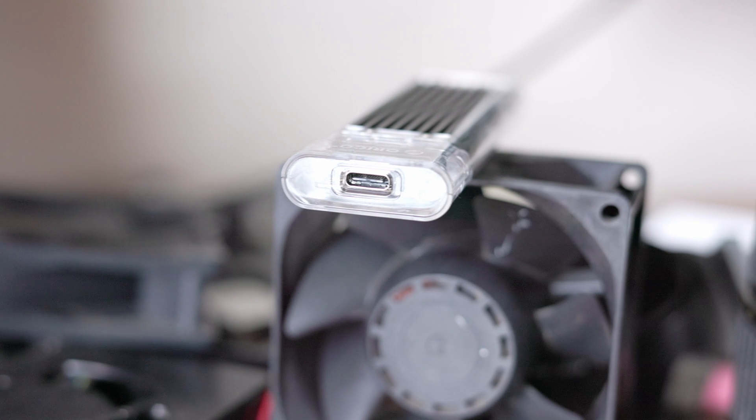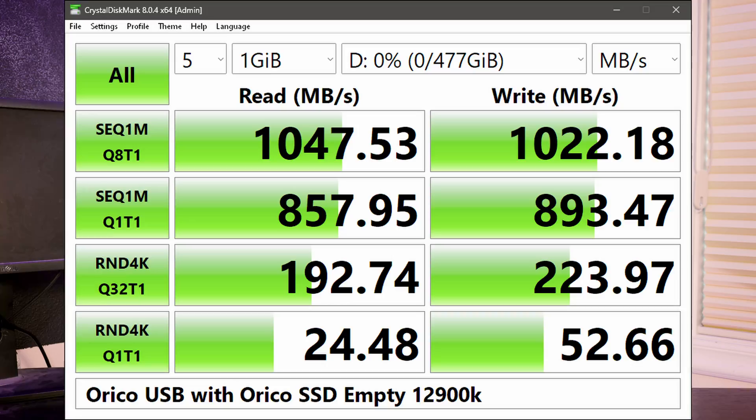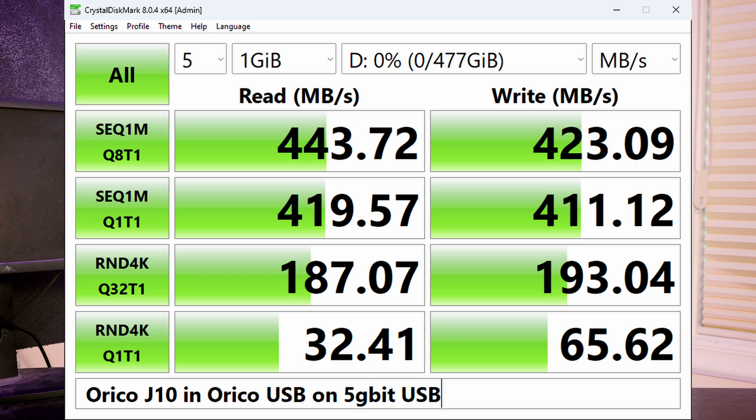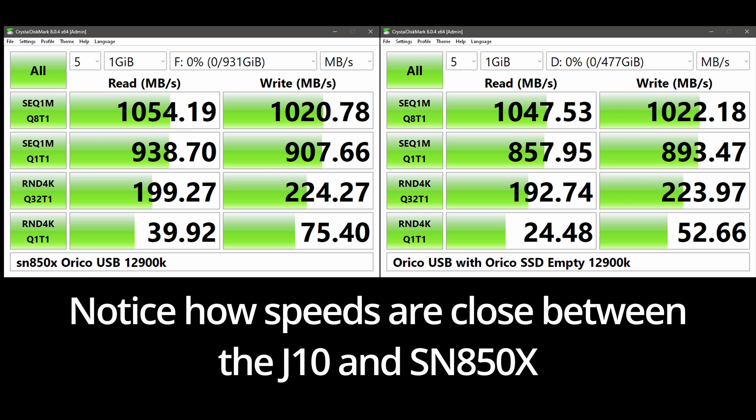Let's take a look at the performance of the enclosure. It has a USB 10 gigabit port, giving just over 1 gigabyte per second peak speeds when copying files. It does require a USB 10 gigabit per second port, which is relatively common on recent computers, but if you have an older 5 gigabit port or accidentally use the wrong port, speeds will be limited. In terms of random performance, it pretty much hits the limits of USB. Comparing it to other higher-performance USB devices, the random IO seems comparable, and trying faster internal drives didn't improve random IO significantly — pointing to a USB limitation rather than a slow enclosure.